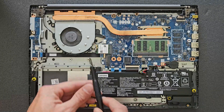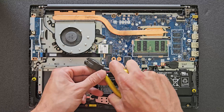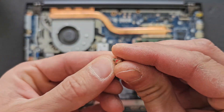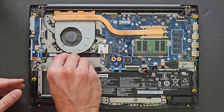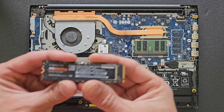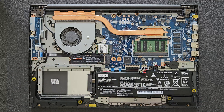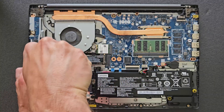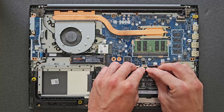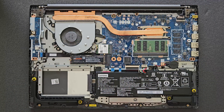Because this is a longer drive, you have to remove that little screw that holds your solid state drive in place. It comes off easy enough — just unscrew it and install it into the other hole. Then slide your drive in, close the screw, and that's it — upgrading done. Only thing: if you are swapping the SSD drive you will have to reinstall Windows. Unless you can clone the system, but I always reinstall Windows — it's not a big issue, 30 minutes and you're up and running, plus installing the drivers again.